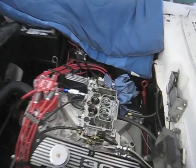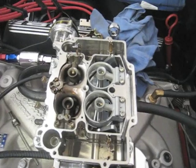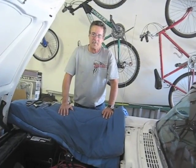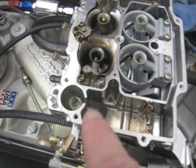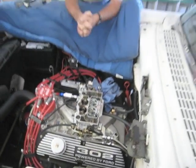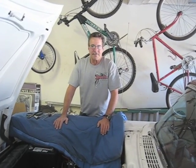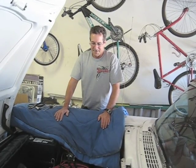Here's the carburetor with the top off it. Those floats fit down into here and over here — there's gas in there. I'm wondering if I'm seeing dirt in there, Steve. We'll have to clean that out. It's always amazing how much sediment seems to get past the filters and collect in the bottom of float bowls. It seems like after a time a carb goes off, there's that very fine little sediment in there — it gets past the filter even. So we'll clean that out and put in some nice fat jets and make this thing scream for mama.